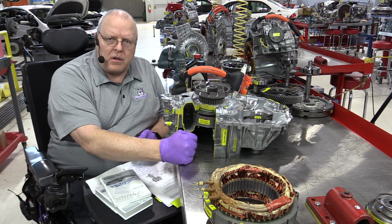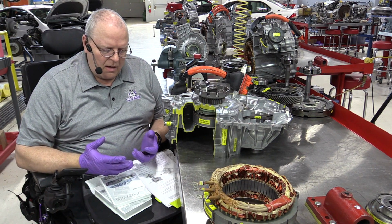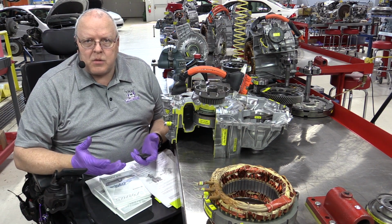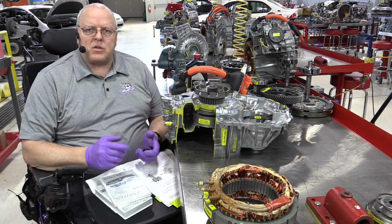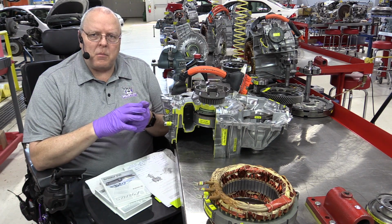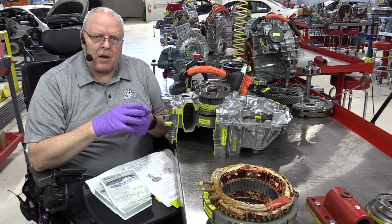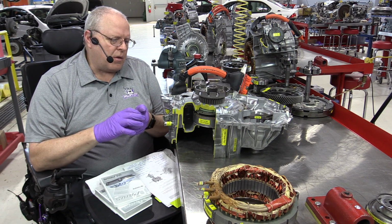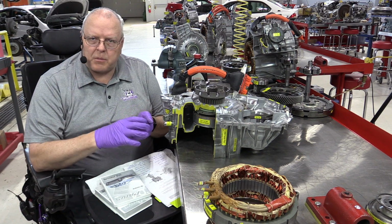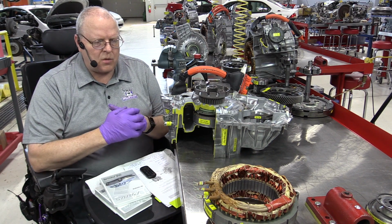the P112. Now, that will allow it to spin at, of course, faster speeds, but faster speeds can also equal higher output voltage, higher power, more current induced into the windings of the MG1 stator, which is part of some of the changes they've made to the P112 transaxle.